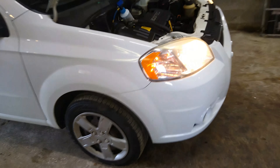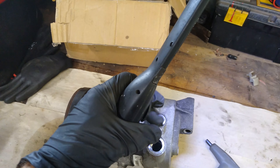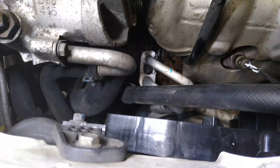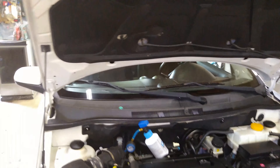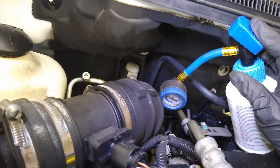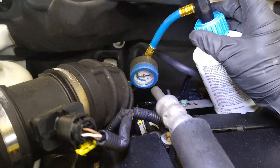Got it all back together — wheel's back on, belt is on, hoses are reconnected up top. On mine, there's a little stud that comes out — you transfer it from the old compressor to the new one, then the lines slide over that stud and you put the nut on top. Now we're recharging with one of these little cheap refrigerant kits — makes it easier if you don't have a full manifold gauge set. Screw it onto the can, turn the car on, AC on full blast, hold it down, and you'll hear the compressor kick on. Fill it up to about 45 psi.